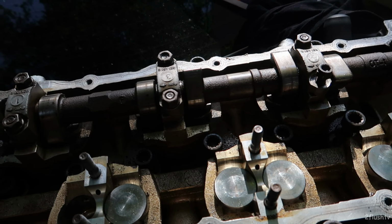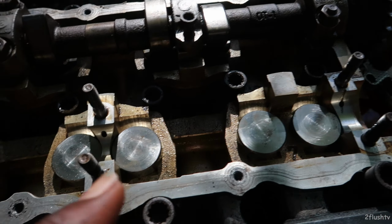If anybody is questioning why I did not go ahead and do all of the valves and springs and just rebuild the head, it's because I was going to do all of the intake valves, but then I was talking with the guy over at Eurotuning, and he said do not just upgrade one set of the valves, do all of the valves at one time. That was about $600 to do the whole head, meaning the exhaust valves, intake valves, and springs. I think I'm going to go back and do that.